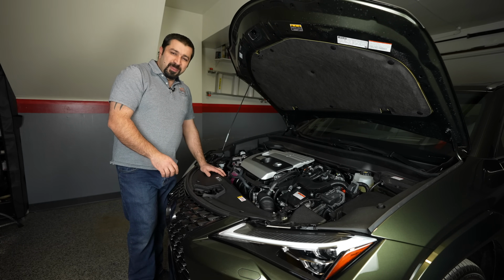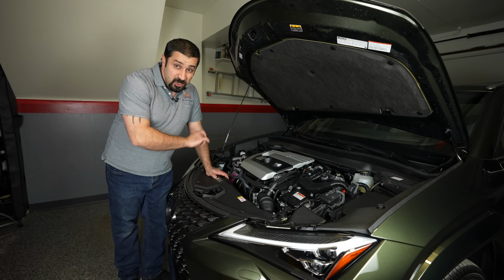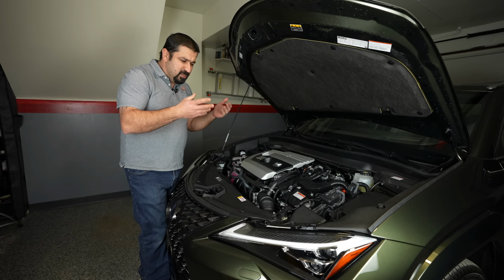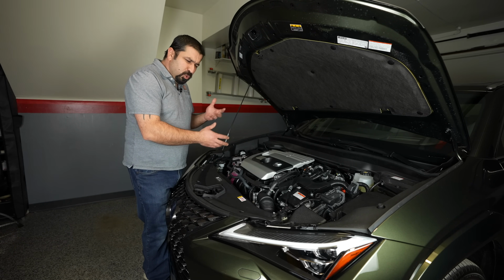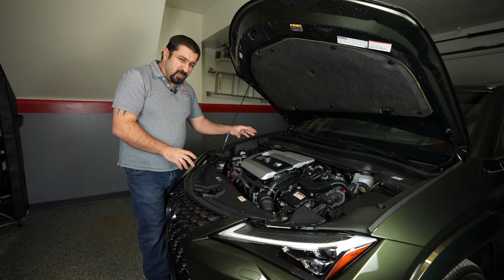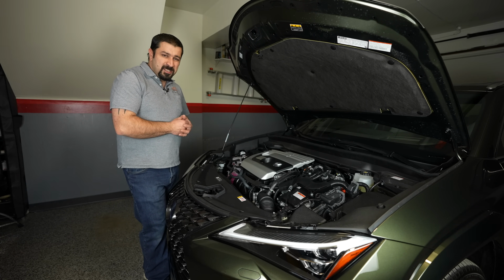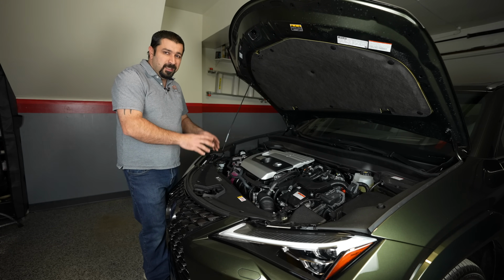But something unique about the Lexus UX, this is the first time in the US, at least, it has been done overseas, that they use this engine in a hybrid system, almost making it a half generation, because they've used a lot of engines, made it to the hybrid system. The 2.5, which is basically the bigger brother of this engine, the A25A, but they've never used the 2.0 in the US, the M20A. This is the first model that uses it. It's really nice because it gives it a little bit extra boost over the outgoing 2ZR-FXE, the 1.8 liter, which is getting a little ancient.